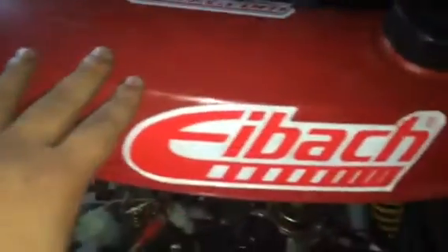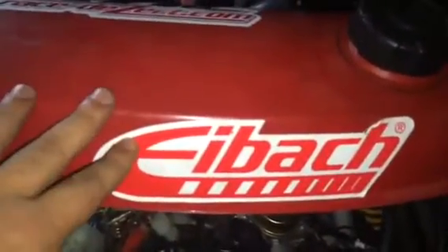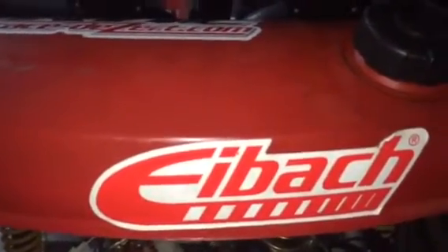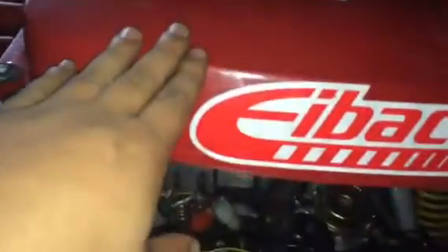You're also going to want to check — make sure you have fuel. As stupid as that sounds, I actually forgot that I drained it because I was having so much trouble with the petcock. Here I am trying to crank it and it didn't have gas in it. But there's gas in it now and it runs. Your fuel filter — once you try to crank it, it should fill up with gas. That's how I know I'm getting fuel.